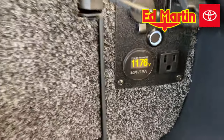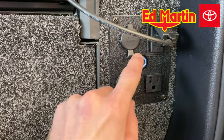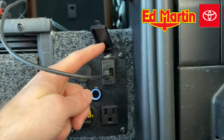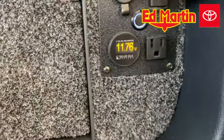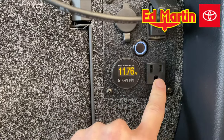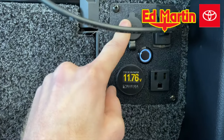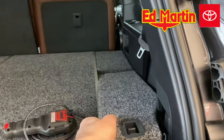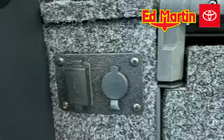We have the inverter on switch with a Helmarine glow ring switch. We've added a couple of USB ports here — one of them is charging the Warn wireless remote. We've added the AC power outlet from the inverter right here. We use a Blue Sea OLED voltmeter, an extra 12-volt outlet, and two USBs. Also, on the left side we have a couple more high-volt 4.8-amp USBs, as well as another 12-volt socket.